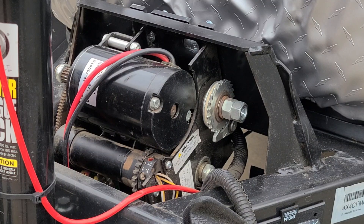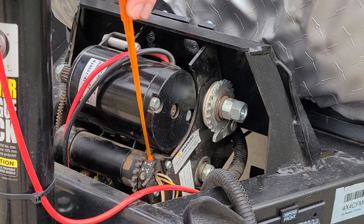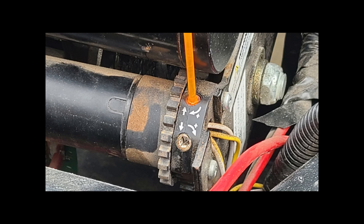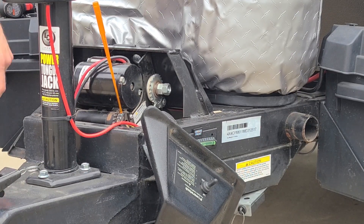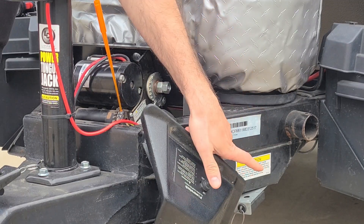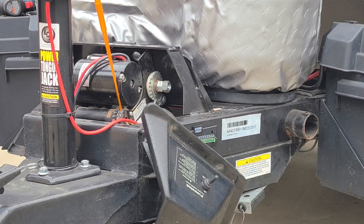Next, we're going to be taking our adjustment tool and placing it in the red Allen slot here. You'll note that there's a plus sign with an arrow indicating which way is the increase and which way is the decrease in the time it will run. What you're going to want to do is decrease the run time with this red Allen screw until the switch just clicks — just like that. This is going to be our base to start fine tuning the lower limit switch.